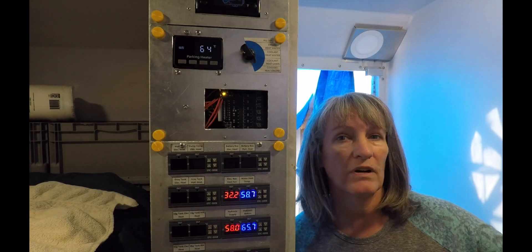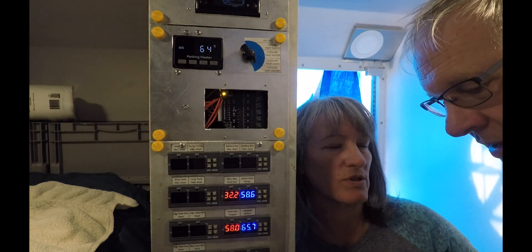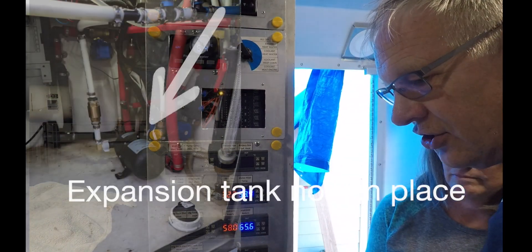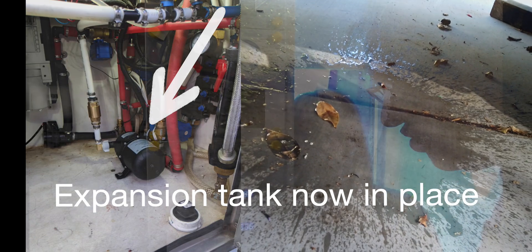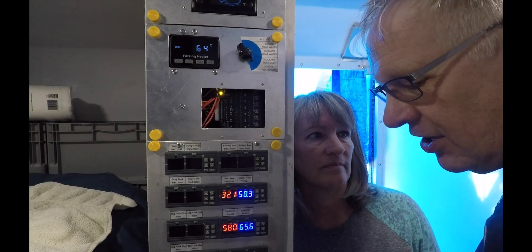I'm going to call it a success, though I need to verify one drip isn't actually several drips leaking down. One thing I think I have to do is put an expansion tank in there, because when we heat the hot water the temperature-pressure relief valve goes off due to pressure — I don't have an expansion tank in the system on the hot water side.